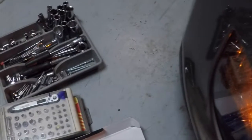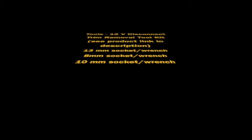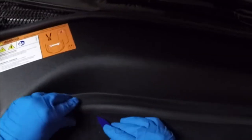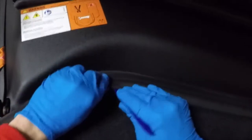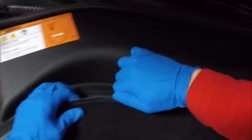So let's talk tools. What type of tools are we going to need for today's procedure? Well, we're going to need a trim removal kit, 13mm socket, 8mm socket, and a 10mm socket. We need to gain access to the bolts on the top of our storage unit here and also on the bottom. The best tool that I found to do this is a trim removal tool. And I'll include a description in the link below to the set that I have. It works very well for all sorts of different types of procedures.